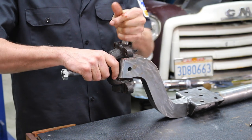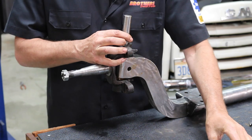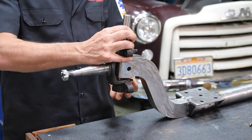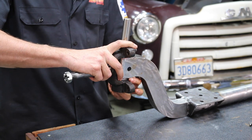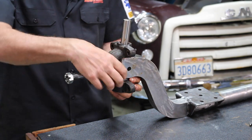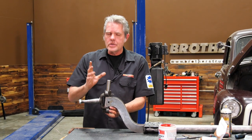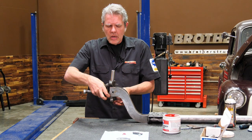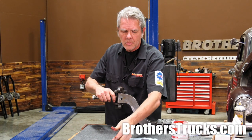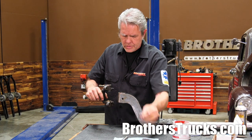We're going to get our kingpin and put it in there. And then we've got our bottom bearing or shim kit here, and we're gonna go ahead and slide that in. Now, it should be kind of restrictive when it goes in. It shouldn't just fall right in, because we don't want too much slop in this. It'll wear it out again prematurely. So that doesn't have enough of a stiffness for my taste. I'm gonna pull this back out. I'll get another shim on here,